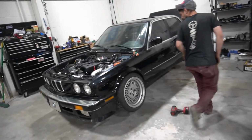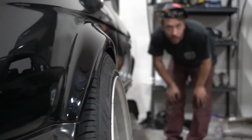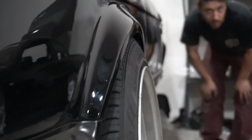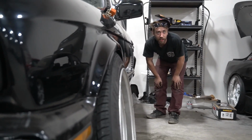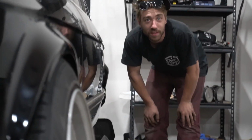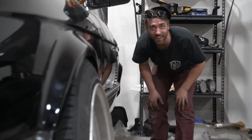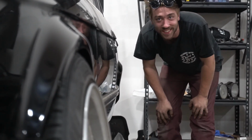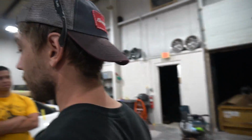What the hell? All right, so if this was a stance car, this would fit perfect, but since we're gonna be going full lock, it'd probably hit the fenders pretty dramatically. If anything, I've learned from my first season of drifting that tire rub kills you, and you should raise your car if you're gonna drift. Tire rub slows your car down, throws your line off, makes everything inconsistent. Can't have it. Honestly, the tight weave just matches the BMW zero thing. And I'll look just like Jip. We can be twins.